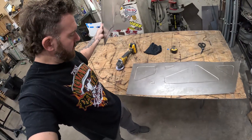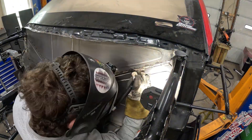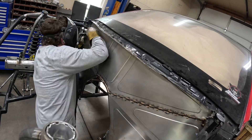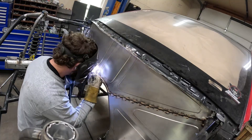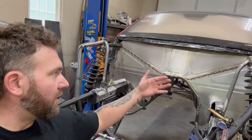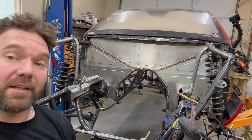Also did the driver floor while I was at it — we'll put that in next week. Back to welding with the silicon bronze. I kind of do it the opposite of the other panel — it looks cool. Maybe there's a reason for it, introduces heat in a different part of the bar. Going to finish up most of the silicon bronze while I'm here so I don't have to get in here and do it again. And there we have a mostly finished firewall — just have to finish welding, then seam seal and paint, and drill a whole bunch of holes. I think it turned out pretty good.